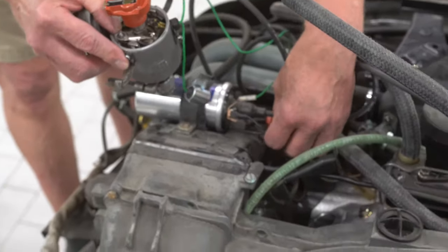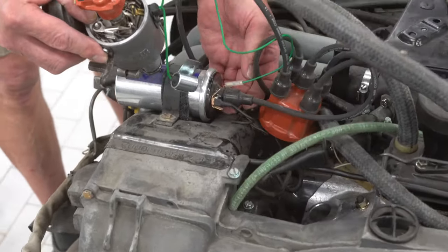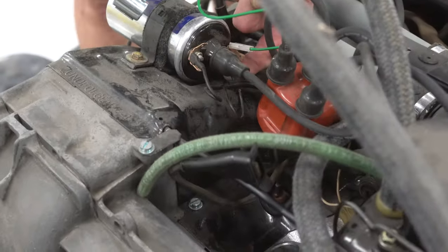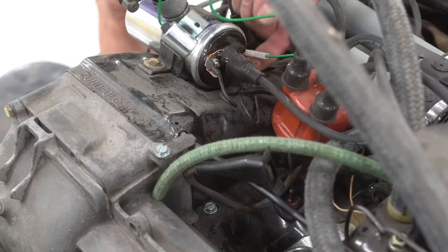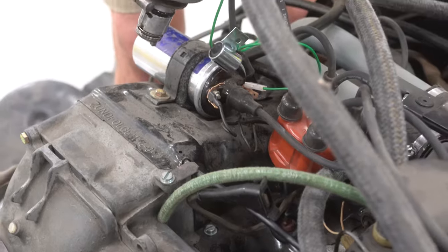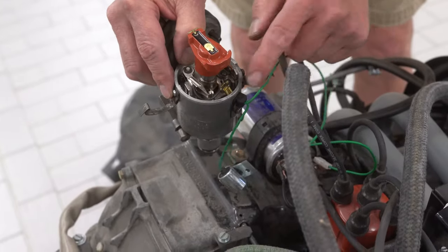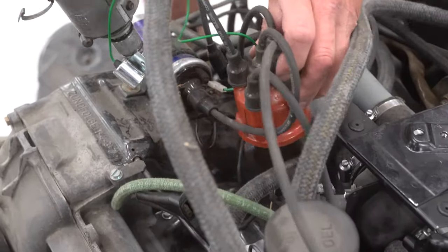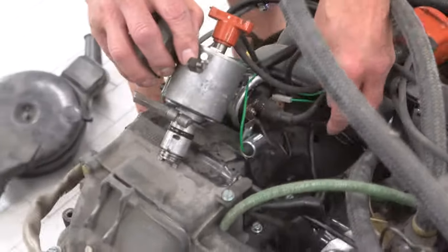The other side of this coil, back to the '1' side, is a smaller black with purple striped wire. That is for the tachometer. Oftentimes people leave the key on and the points are not working, so they're about closed, and they will burn out the condenser wire and go to the tach and burn the tach wire — so you really want to avoid keeping the key on when you're playing the radio or when the car's not running.